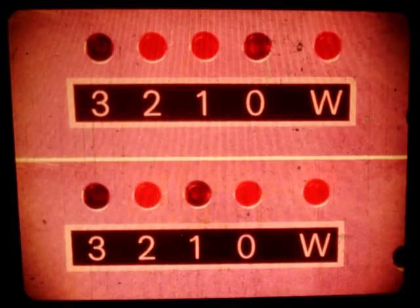The computer shows a temperature sensor failure for TW as LEDs 2-1W lighted, and for T1, LEDs 2-0W lighted. If there is an open or shorted wire in the circuit, the ECU display will also light up.